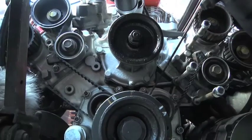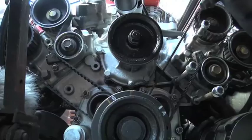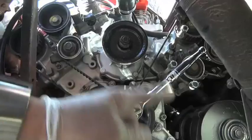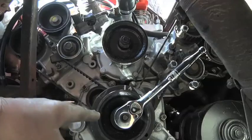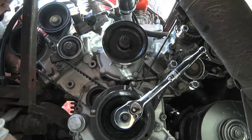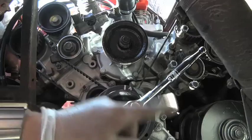That's the way I'm doing it, and I'm putting my car engine on it. Hopefully that was some help. To rotate the engine, use a ratchet and remember: go clockwise. If you go anti-clockwise, it won't damage the engine, but you'll put tension on the wrong side of the belts and get a false reading on the camshafts. So make sure you go in a clockwise direction - and if you miss the marker, just go round again.